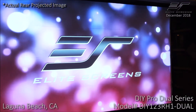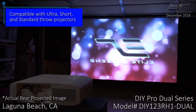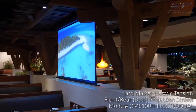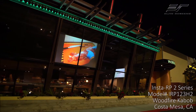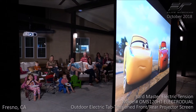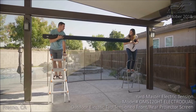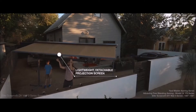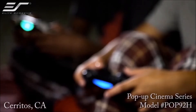Projector screens can also be either front projection or rear projection. With rear projection, the projector is positioned behind the screen facing the audience, while front projection has the projector facing the screen from the front. Even though rear projection requires a lot of space behind the screen, it is beneficial in environments with a lot of ambient light such as outdoors or a TV studio. If you're considering projecting outdoors, the first thing to consider is placing your screen away from sunlight — such as under a covering. Elite Screens has an awning system to help block sunlight, and their Yardmaster series includes fast-folding frames, pop-up screens, electric motorized screens, and other outdoor options.